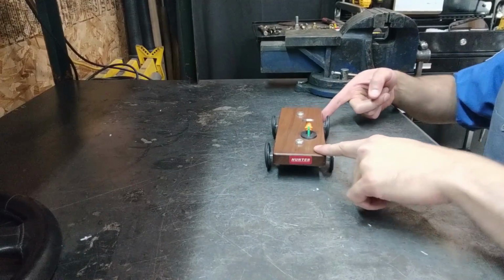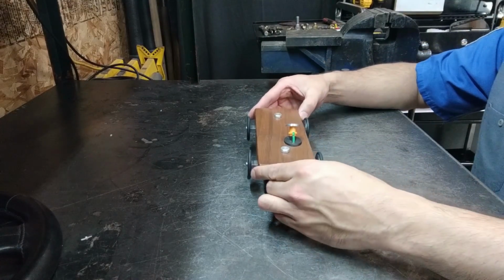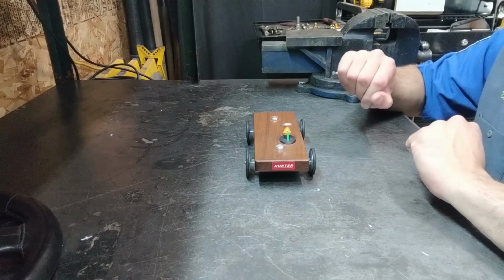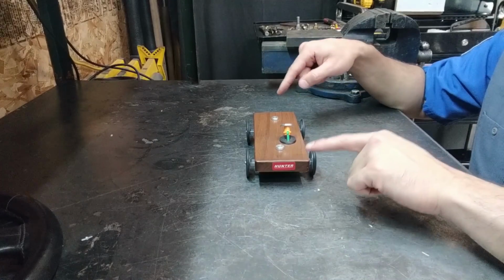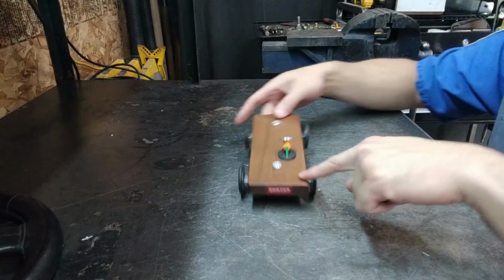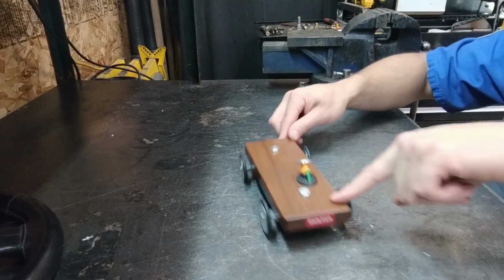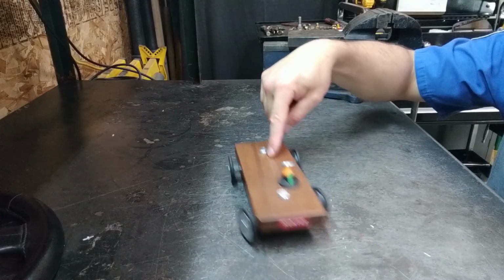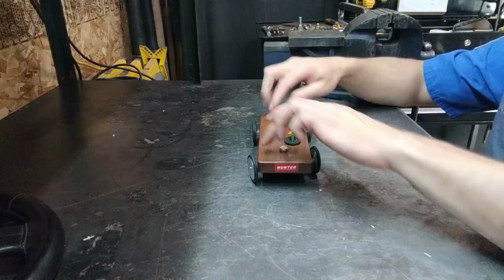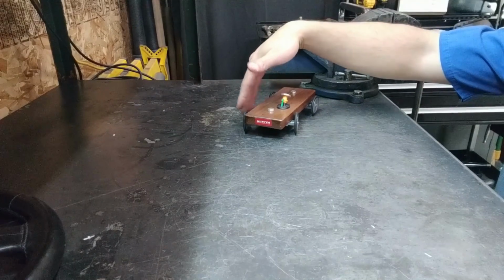During an oversteer event, where the vehicle is turning more than the driver is intending, the system is going to interpret all of the inputs and determine that it needs to take over control of the vehicle. And it's going to apply individual brake circuits in order to correct the vehicle from going into a sharper turn than desired. By doing that, it's going to apply the brakes to the outside. If this is the intended turn and the vehicle is trying to turn more than the intended amount, the wheels that are on the outside of that turn, so the outside wheels, which would be on the right side of this model,